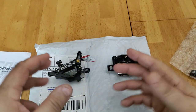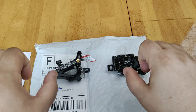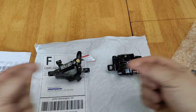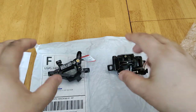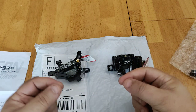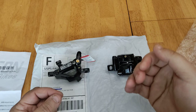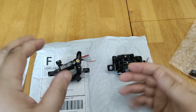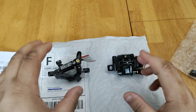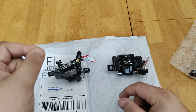A lot of the e-bike levers have not just the levers for braking, but also the motor shut-off wires as well. So you usually have two wires coming out of the levers — one of them stops the motor whenever you press the brake. A lot of those whole kits don't always have that shut-off capability, so you have to keep that in mind.